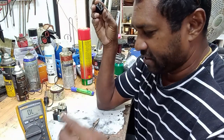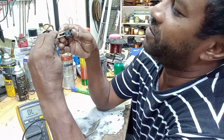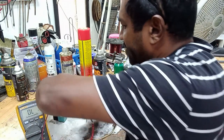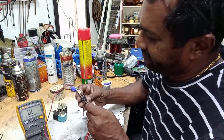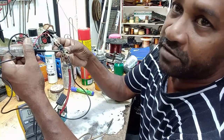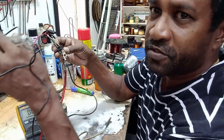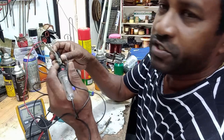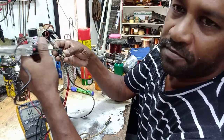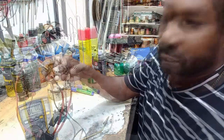Let's test that quickly. I have voltage here on the coil, but there's no ground signal yet. When you flip a switch, push a button, or turn the key on the vehicle, you get that ground signal and the relay conducts. I put a test lamp on the contact side with ground connected — and you can see no power yet. Now I'm going to energize the relay.